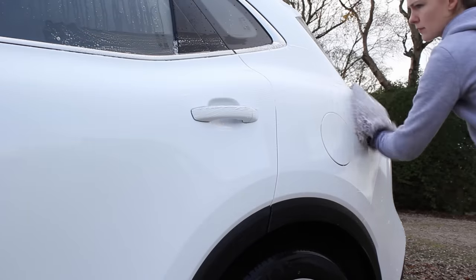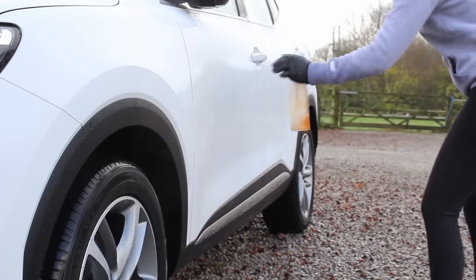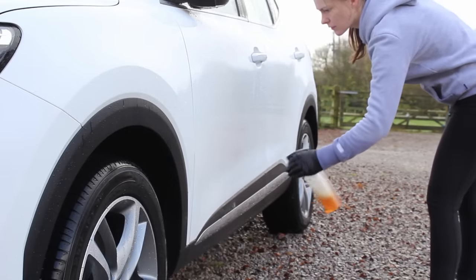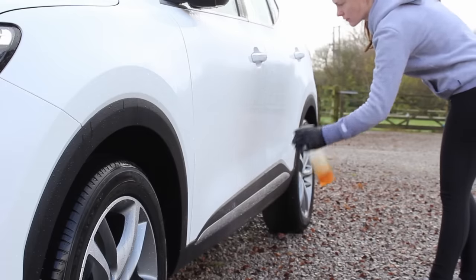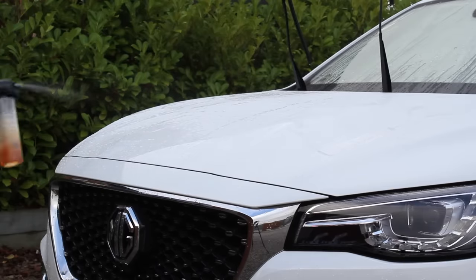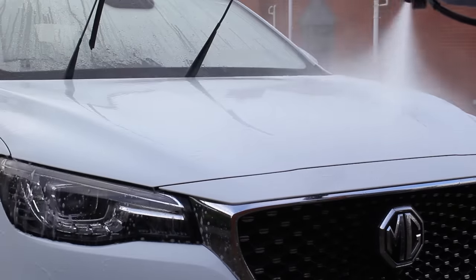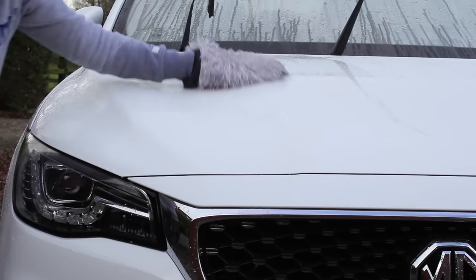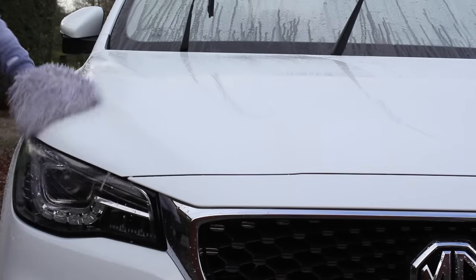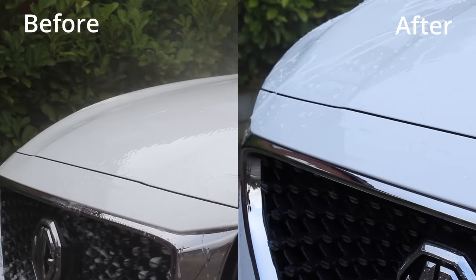What I like to do now is use an acidic shampoo — an example is ADBL Tangy — or a dedicated water spot remover to tackle mineral deposits. The thing to note is that water spot removers are very acidic, so depending on the protection on the car they might be too strong and could strip it entirely. To dilute it, I spray it onto a wet car and then work over it with a mitt and shampoo to dilute it slightly. Once rinsed off, I typically notice a revival in the water behaviour of whatever protection is on the vehicle.